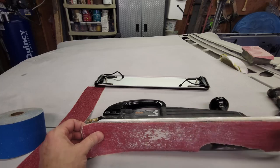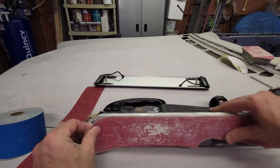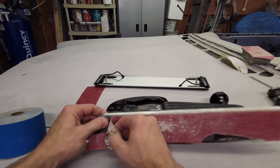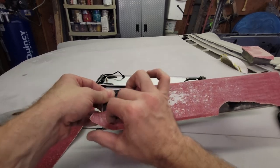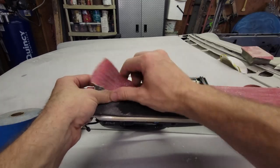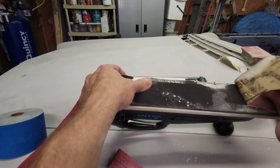I'll pull the sandpaper out and show you my issue. I had a long strip clamped on both edges because I don't trust the sticky back — when body filler dust gets behind it, it doesn't stick very well. As you peel this off, this backing material wants to come off, and when you peel off your medium you'll see it starts to tear — it's sticking to the soft pad. That's one of the issues.